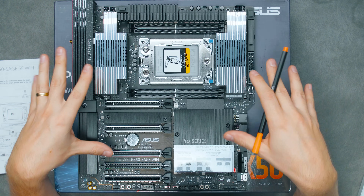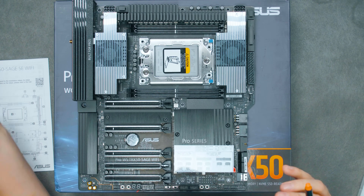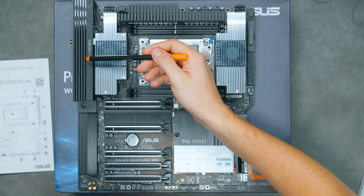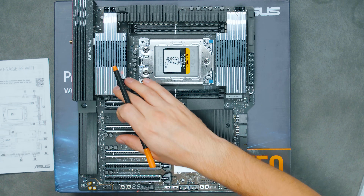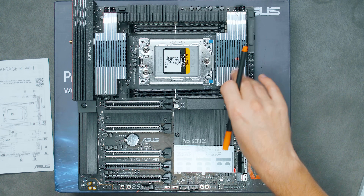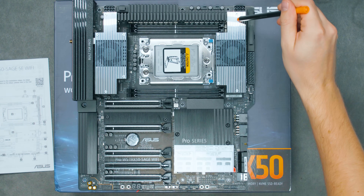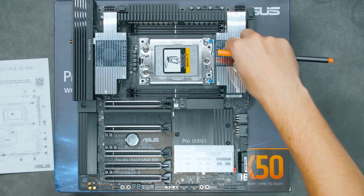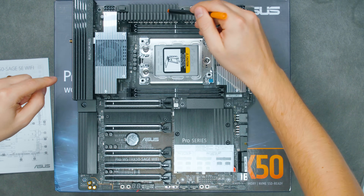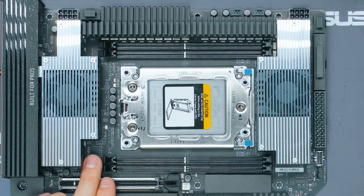Here's the motherboard, and it's a lot different from what we usually see. There's some overclocking stuff and service-oriented features going on. One thing we see straight away is a pro design — we see heatsinks for the chipset and for the VRM. This board has 36 power stages, and there's a big heat pipe that goes underneath all the way across. There are fans on both sides, and two heat pipes split in the middle cooling all of those power stages.